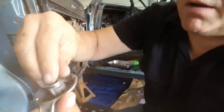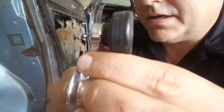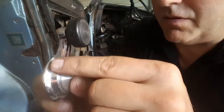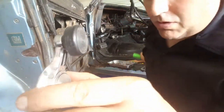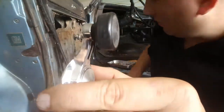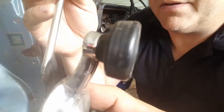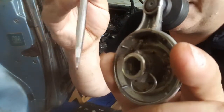How do you take it off? When it's on, you're going to need to move the window crank — or the door handle, but mostly window cranks — all the way to the top position right there. Then you're going to use a tool like this, or you can use two flat blade screwdrivers. The tools are pretty easy, but if you're looking at this, you may not have the tool.